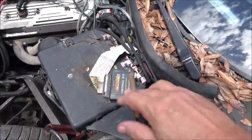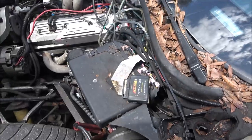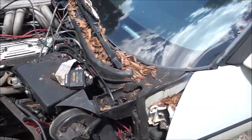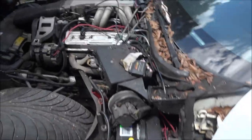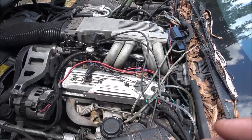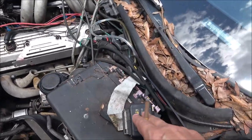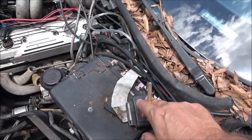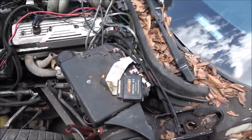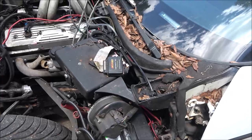This computer — they've got this Ostrich on here, so it needs to be detuned. It was all set up for that supercharger. I don't have a supercharger on it. So I'm either gonna have to detune this, or I think the easiest thing — because this is a plug-and-play computer — I can just buy another computer and put it in it for like a hundred bucks.